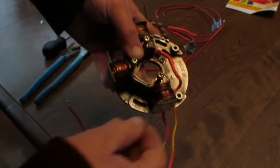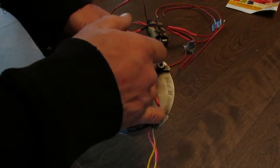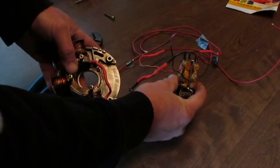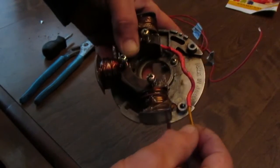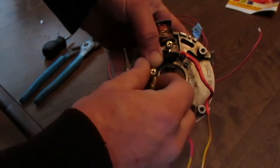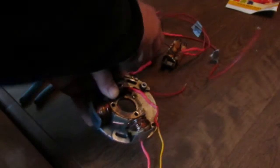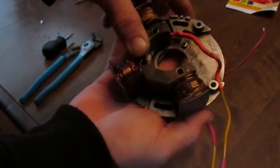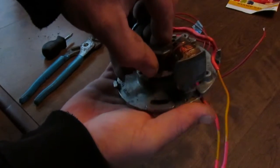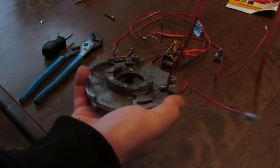For illustration, your ignition coils usually have two screws that hold them on. You've got your trigger coil and your charging coil, and then on this style of stator — mid-80s Arctic Cat — there are at least three screws. Take those screws out and you can pull your plate right off, and then you have access to what's going on.